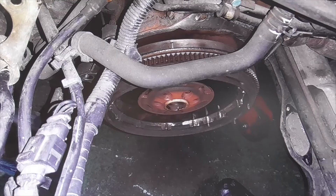That is what the dual mass with clutch and everything costs — for a car that is already about 20 years old. The man said it was not worth fixing, but he did not know that a monomass can be installed in this vehicle. The monomass costs approximately 240 euros — much less. So after talking to him, in the end he will install the monomass on the vehicle.